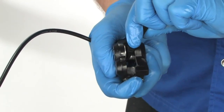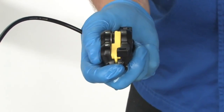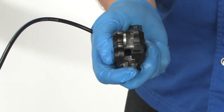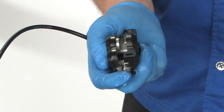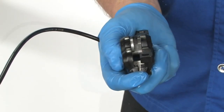Push the piston back into the caliper. Install the bleed block into the caliper and expose the same piston again. If it is still dirty, clean again with cotton swabs and alcohol. Apply a few drops of genuine Shimano mineral oil to the sides of the piston. Do not use any other type of lubricant on the piston.